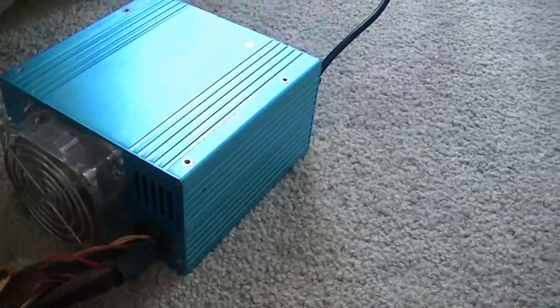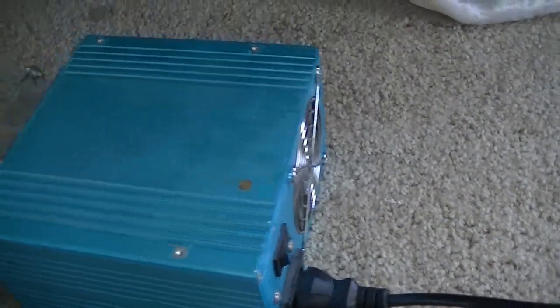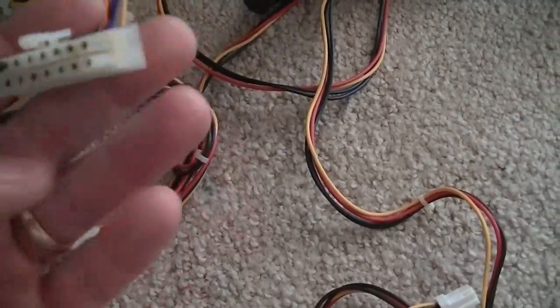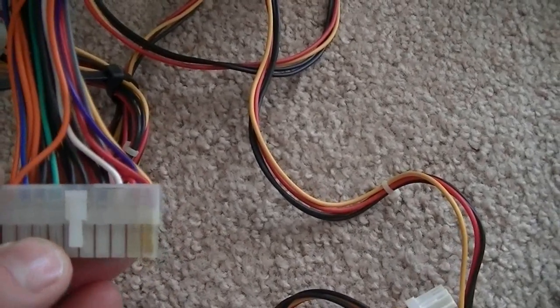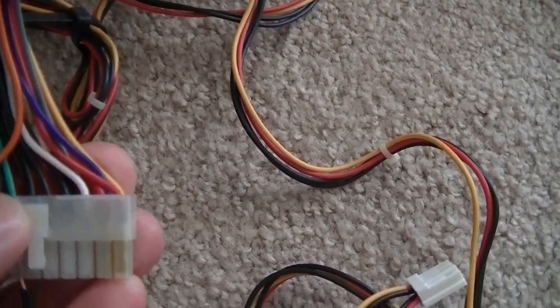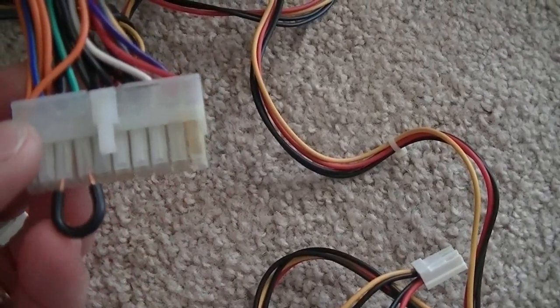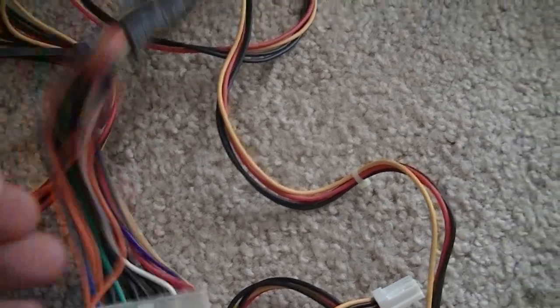Which is why, when you have your computer together and you just throw the switch in the back of your power supply, it doesn't always just turn your computer on — a lot of times you have to hit the power switch on the front of your computer. What that does is it actually connects these two leads. On your motherboard connector, you should have only one green wire, and right next to that green wire is a black wire — there are a lot of black wires and they're all grounds. But if you connect the green wire directly to the black wire — I just use a jumper here, just a piece of solid 14-gauge wire — and I connected those two wires together, it allows the power supply to turn on.